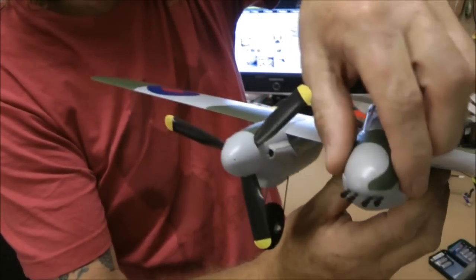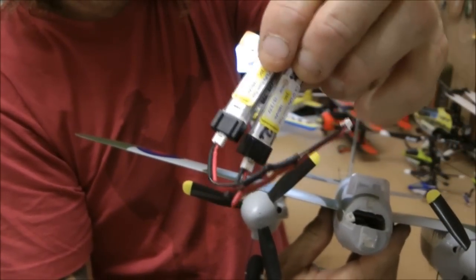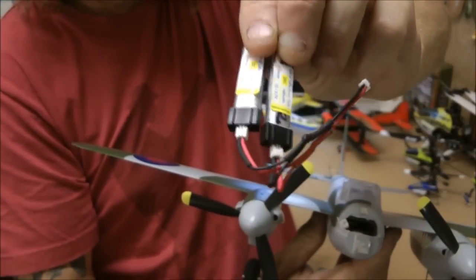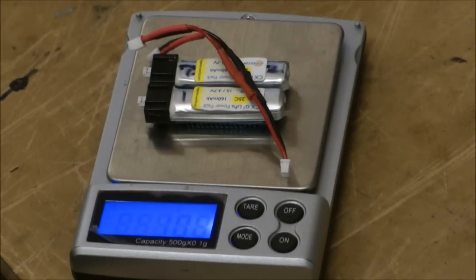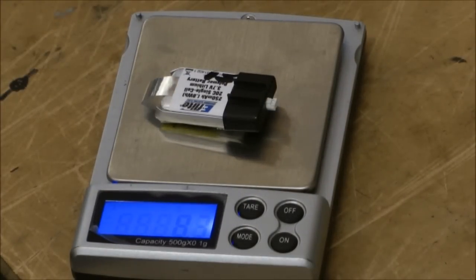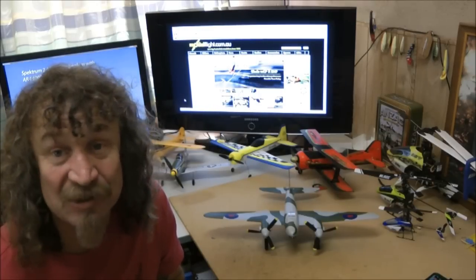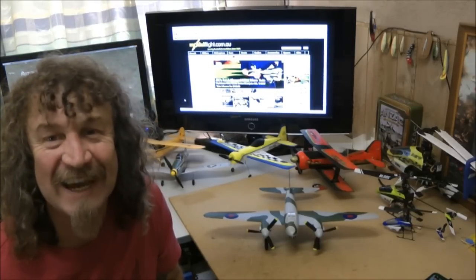We have it bound. A few folks on RC Groups have talked about using their 1S batteries and putting two together, so I thought I'd give it a go. It looks like a pair of Hyperons. I made up a little parallel connector so I can put two of them together. It'll be interesting to see how these two 160 Hyperons go in this little baby. The two Hyperons and my connector come in at 10.8 grams. The stock battery comes in at 8.3 grams — it's only 2.5 grams heavier. When you consider it also carries the key cam, 2.5 grams is nothing. Having two 160s giving you 320mAh with the 30C Hyperons, I think you're going to get good flight time.